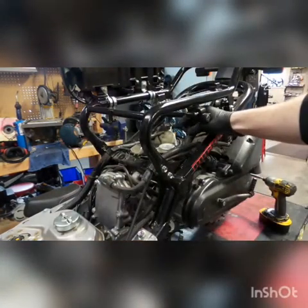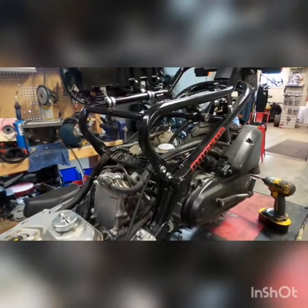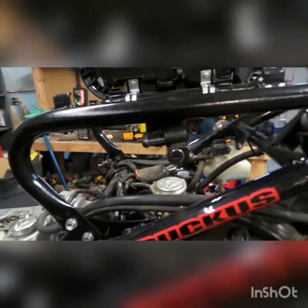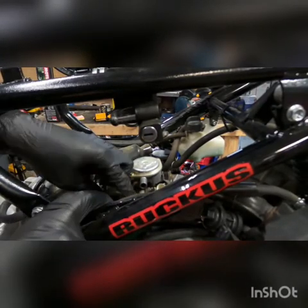You can do this in the bike without taking little things like the throttle cable out if you feel like it, but for this video I'm going to take the carb completely out so we can actually see what's going on inside. You have your throttle cable — it's a 12mm bolt, pretty easy to get to. On the Ruckus it does have, for the CV, an air filter hose that goes to the top of the carburetor. You also get your choke and your throttle position sensor — those are nice easy connectors. The wires connecting the throttle position sensor sometimes can be taped.